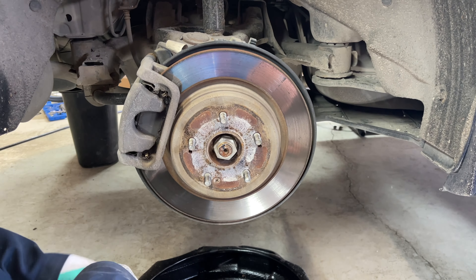You remove it and don't actually have to replace it if you don't want to. More often than not these things are rusted in pretty badly, but the easiest way to remove it is to use a drive punch with a pointed tip and then take your hammer and pound that in until you dimple it, to get a little groove on the head of the screw.